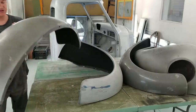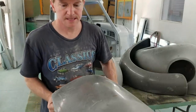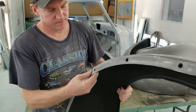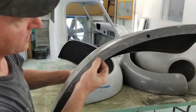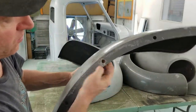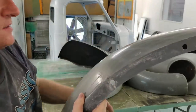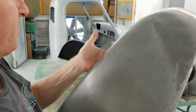We're going to start off with the passenger side front fender. Overall, not bad. We have a problem right there — that's cracked right there. I'm going to have to repair that at the hole there, you can see. That's not good. And it's got a spider web out into the gel coat, so that's not good as well. That's going to need to be repaired.